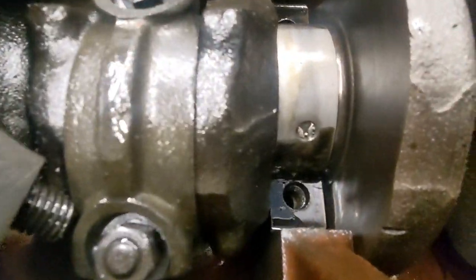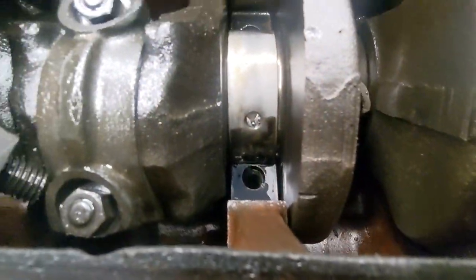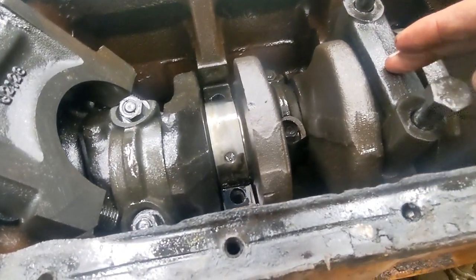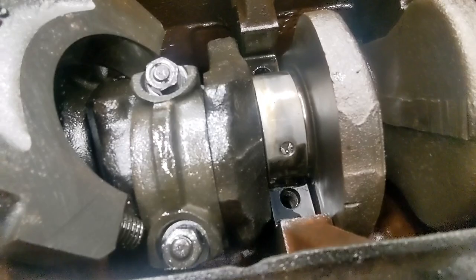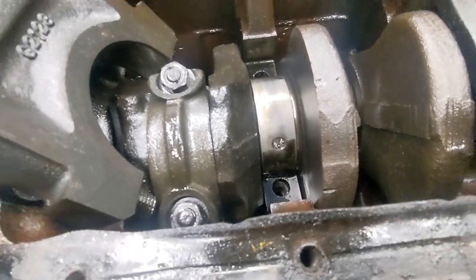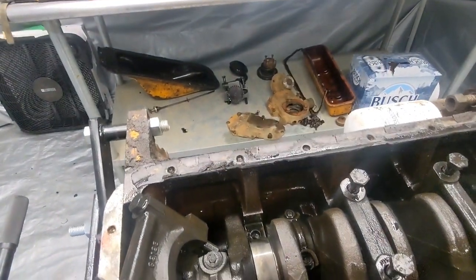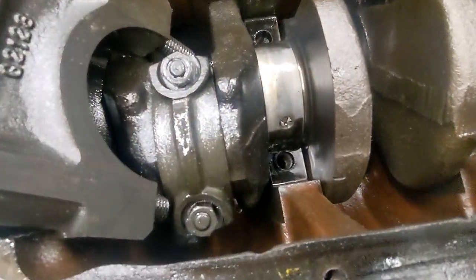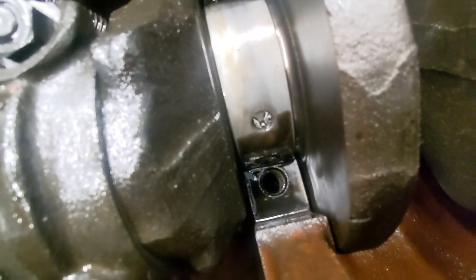So I just pulled this next one - you can see all that melted bearing material in there. I'm surprised this one measured okay with the plastigauge. That's kind of an old school way of measuring stuff - a lot of people don't use it anymore, they use fancy bore gauges. That may be the reason why, because these bearings are definitely hurt.